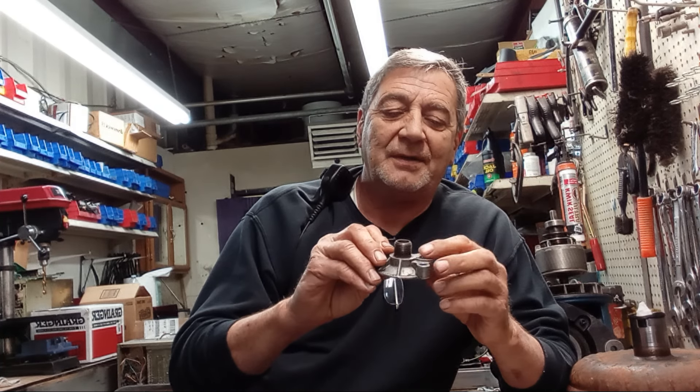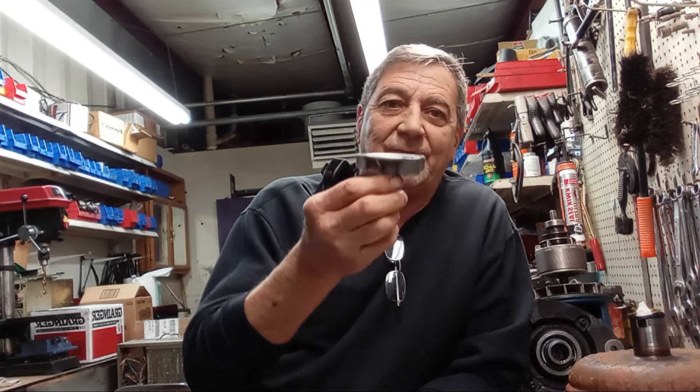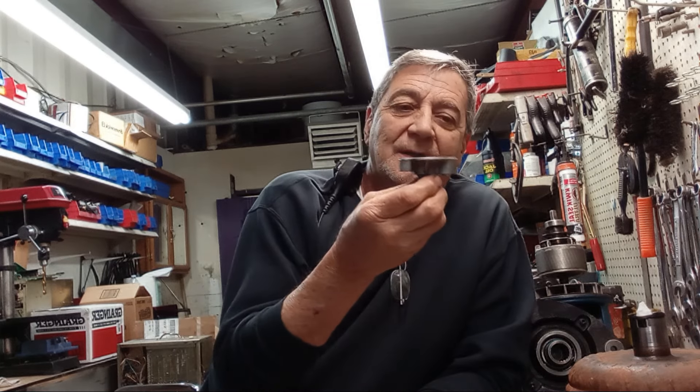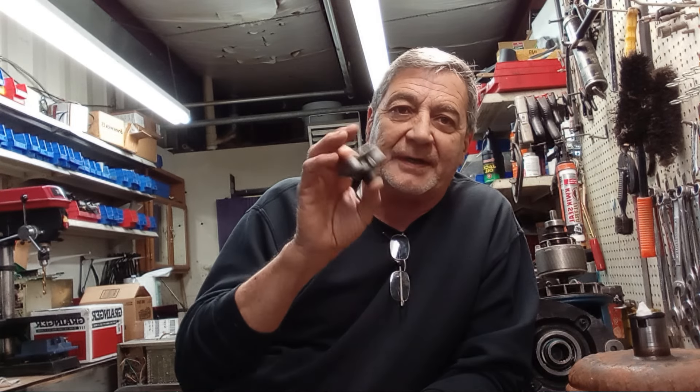A good thing to do is if you had two of these adapters, you could use one that is blocked off. They just bolt with two 7/16 bolts up into the block, so it's easy to pull your filter off, pull that out, put the one with the bypass blocked off on there, put the screws back in, then put your filter on. During your break-in you don't have to worry about that because your oil filter is going to trap everything. I know some of you are thinking your oil filter is going to catch it all anyhow, but GM built that bypass in there because they figured there'd be some of us that weren't going to be real good at changing our oil.